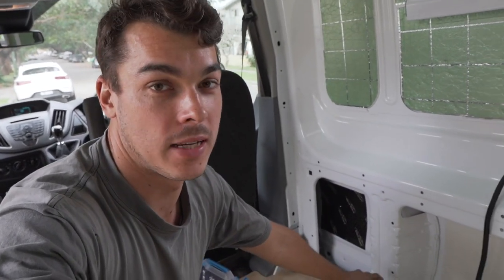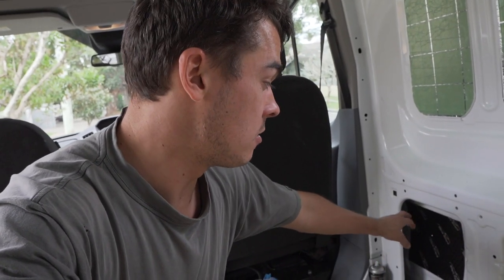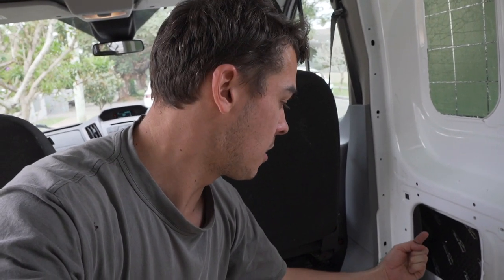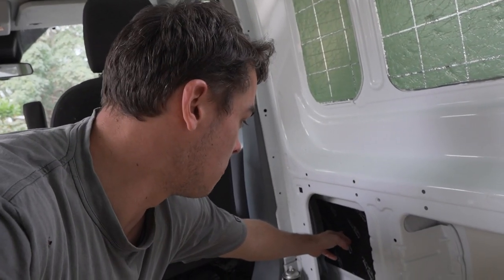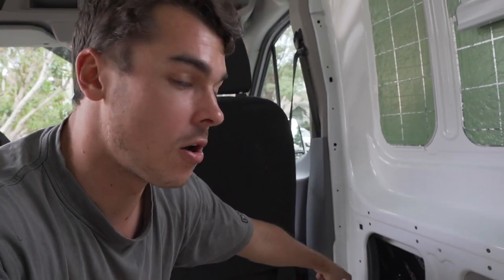Now I'm going to install the water filling point. Directly under here is where the water tank sits that I installed. I'm going to have a fixed filling point that's lockable from outside the van, with the fill hose going down and the breather hose going up the other way. I'll draw a pilot hole just to make sure that's directly where I want it — it's good to poke a hole through just to be 100% sure before you drill. Now I'm going to go drill it out on the other side.